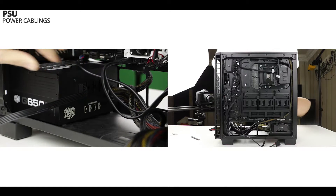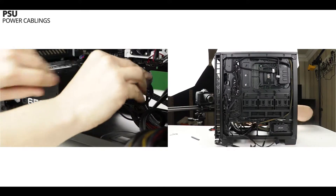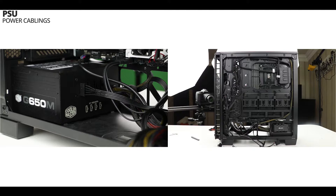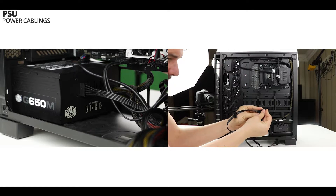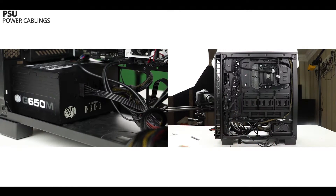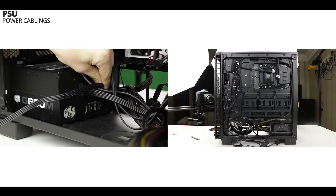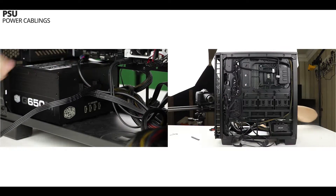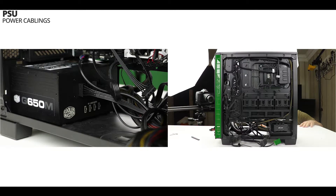On your screen, you can see the different power hubs that we are going to connect with our power SATA cable. When plugging it in, make sure to follow the orientation of the plug — if you have any doubt, double check it. Our second modular plug will simply power our three front-facing fans; again, make sure to follow the orientation of the plug and simply plug it in.